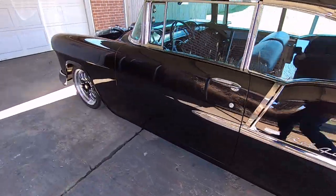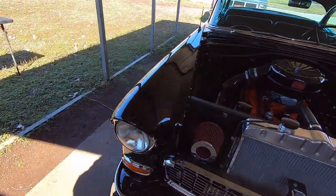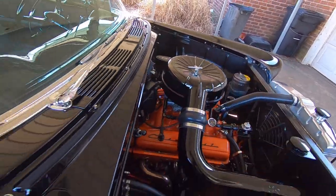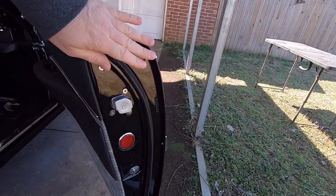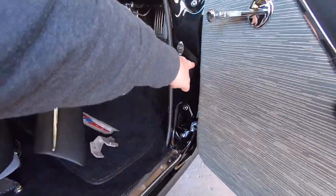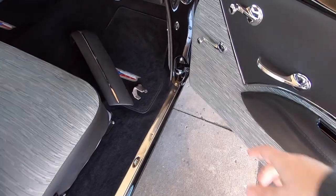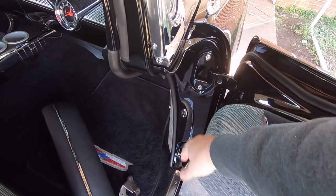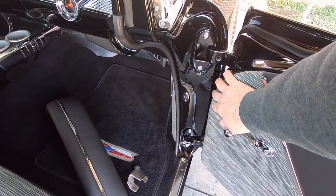I still have to do the flippers, finish the hood, upholster the trunk, and finish the seat shells. I even made my own wing nut — it's an exact replica of the hood bird ornament that goes on the car. All the door jambs got completely wiped with filler and blocked out slick, with big indents molded in and plated. The door hinges were really rough from the factory — I flattened the edges, chamfered them, drilled a speed hole, chamfered that, and put silver paint detail in it.